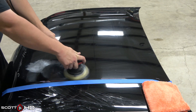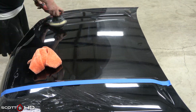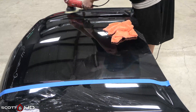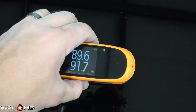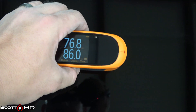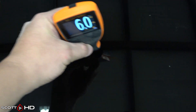Now we're going to get to polishing, still using our Harbor Freight Bauer 20mm random orbital. The pad is an IGL cutting microfiber and we're using Shine Supply Chop Top for the compound — a diminishing abrasive. Before and after: unpolished was 76 gloss units, polished is 89. That is a noticeable difference — not only are the defects removed but the gloss level is significantly increased, and that's just with a quick pass of compound.